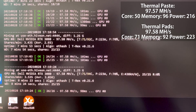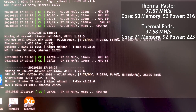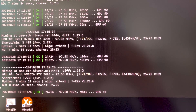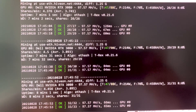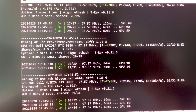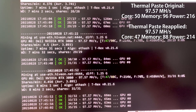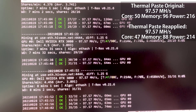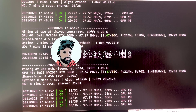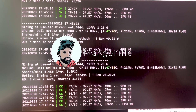No real surprise because I was expecting this, but so many of you suggested doing it this way that I had to give it a try. So I'm going to go ahead now and do the complete opposite — take everything all apart again and go back to thermal paste. Something unexpected happened: I went ahead and did the original modification once again. The only difference is I used a bit more thermal paste. Now look at this: core at 47, memory is between 88 and 90. So we're getting even better results using the thermal paste than the thermal pad. It looks like the original idea and the original video still holds true.